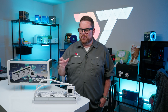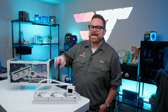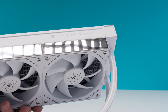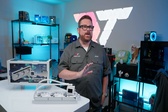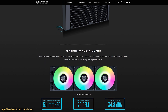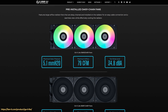Air pressure took a bigger hit, coming in at 2.21 millimeter H2O compared to the Pro's 2.62 millimeter H2O. That's probably the most important stat — static pressure is how much power the fans have to push air through, which cools the actual radiator. Overall, those fan specs are pretty typical for a budget AIO — not the worst we've seen, but not the best either. If you're looking for an AIO with better fan specs and better cooling for only a few dollars more, the Lian Li Galahad 2 Lite offers almost twice the air pressure and more radiator thickness. So depending on what you're after, it may be worth shopping around if you're looking for the absolute best spec for the price.